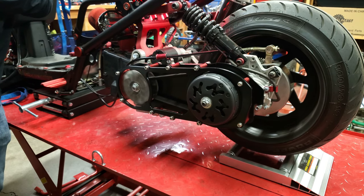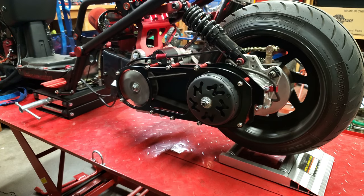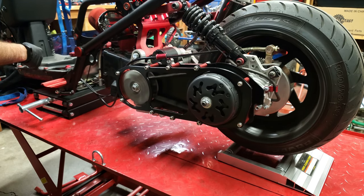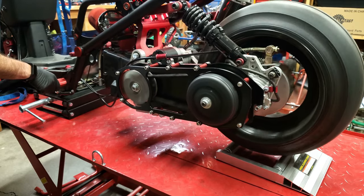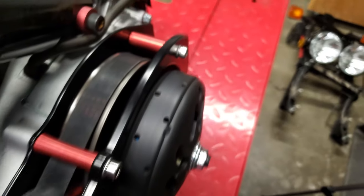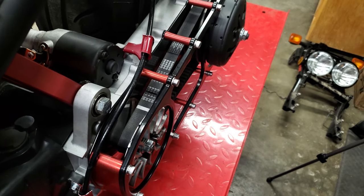She's cold - hasn't ran in a while. That's what she looks like. I'm going to show you one more video on this so you can see the inner workings of the CVT transmission. See on the clutch the belt's out far and it's in the middle on the variator. I'll start it back up and show you what it's doing. You'll see that once the RPMs go up, this one moves out and that moves in once the clutch actually engages.